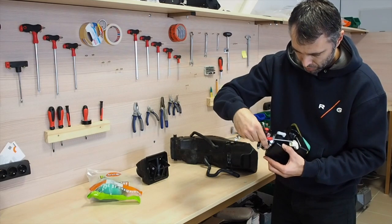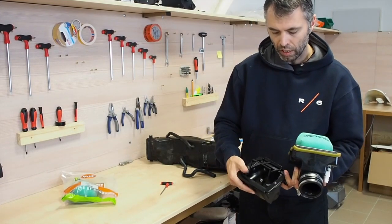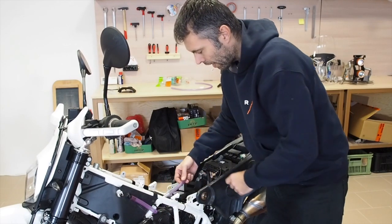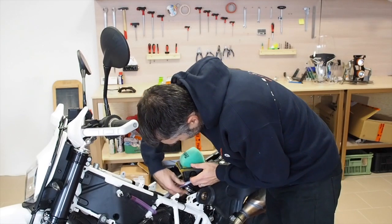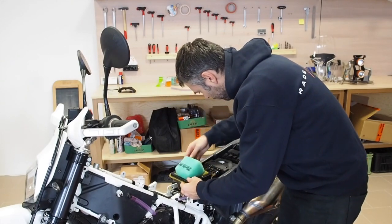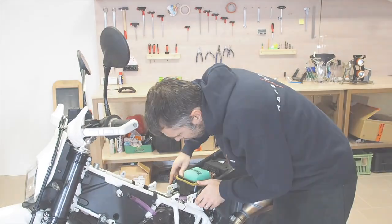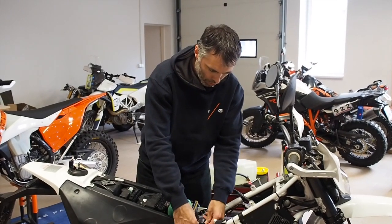What is important — what you can see here is already the foam filter. Here is the inside cage, and this is the outside frame that holds the foam in its place. Now, finally, we can install the airbox. You can see the tubes — one goes here, here is the T, and this one is ready for the installation of the airbox. So just put it in. Before inserting the airbox, make sure you have the heat sensor connected. Now push it on the intake. You will see that it kind of clicks, and then push it there carefully. Now I'm having in hand the hang holder — it goes here, actually, to the same holes as the OEM airbox.